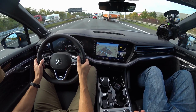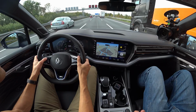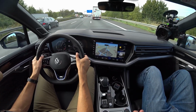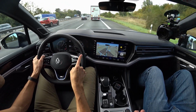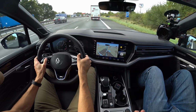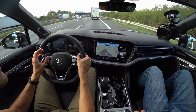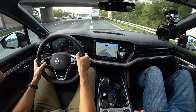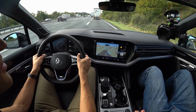And to increase or decrease the speed, here you can either press slightly for 1 and 2 kilometer steps, or now I see you can drive a little bit faster and press it harder for 10 kilometer steps. This is the same as in the ID.3 or in the new Golf 8, but recently different in the Volkswagen Tiguan facelift, because Volkswagen realized that hardly anyone realizes, and sometimes you don't really get the right pressure for 1 kilometer steps or more for 10 kilometer steps. And now in the Tiguan, the same as when you have the steering wheel that is non-capacitive with the real buttons, +1 or -1 is on set and resume, and the 10 kilometer steps are then on plus and minus. And I think that's also the overall better solution, definitely.